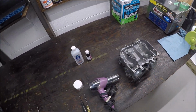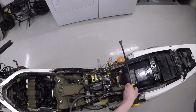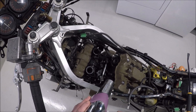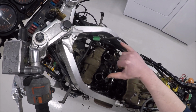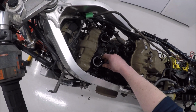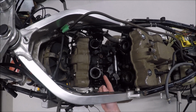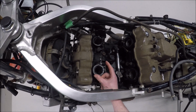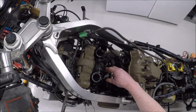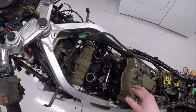Now when we're ready to put it back in, before you even go to put it back in, I'm going to need to go get an extension cord, but we are going to heat these boots way up. These front 2 aren't as important as the rear 2, but I'm going to heat all of them up. Put your clamps on where you're going to be screwing them back in. Make sure that these are aligned correctly because you can't really change them after you have the clamps back in. I've screwed that up before, so make sure you do that.